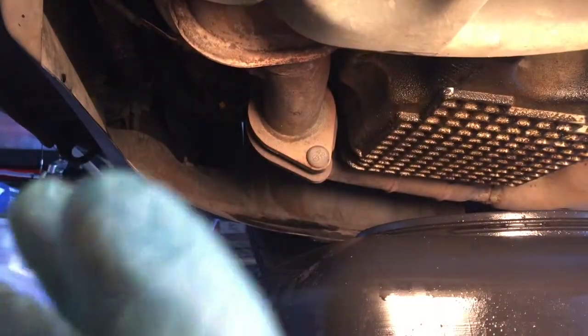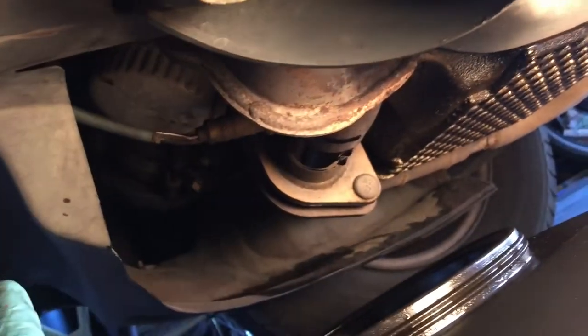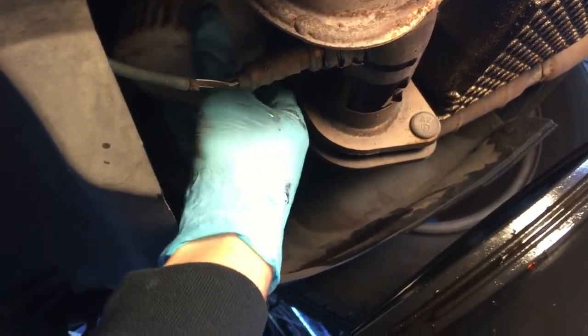Now I should be able to move this back underneath to catch the oil and use the oil filter wrench to take the oil filter off. It's coming off super loose now. This is the part where we're going to get messy whether we like it or not. Since it's already saturating the oil pan, I'm going to let it drain a little while, and when it's drained as much as it needs to, I'll pull the rest off so I don't get oil all down my hand. No matter what, you're going to get an armful of oil — I've not done this without that yet.